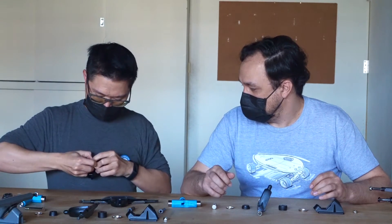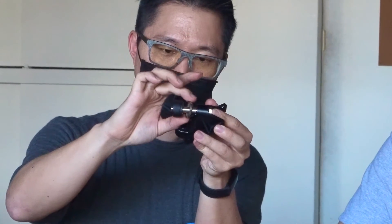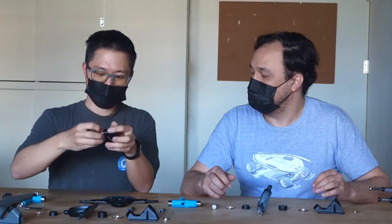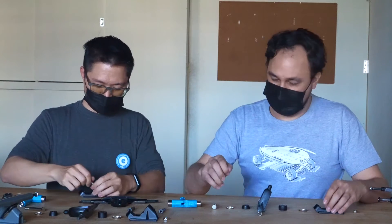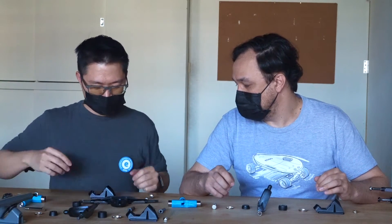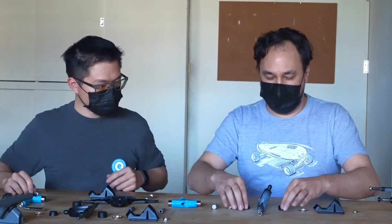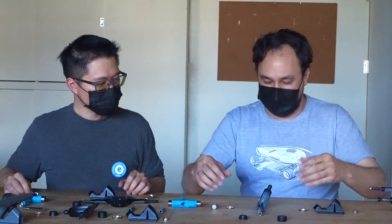And here is your barrel bushing. You can see this is the kingpin right here, and this is the barrel bushing, and towards the end of it has an end cap washer. So I'm just removing all the parts so you can see clearly. With everything laid out, I'm basically switching out my two bushings and my two end caps.